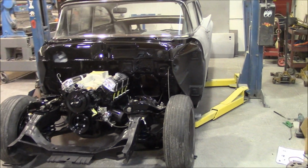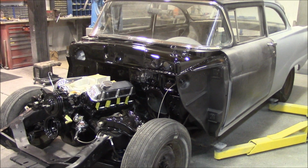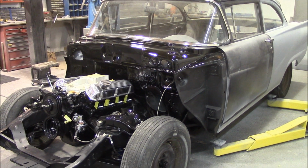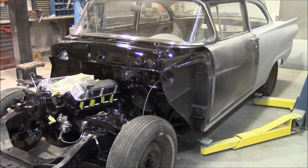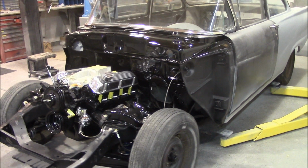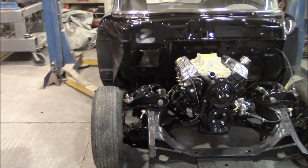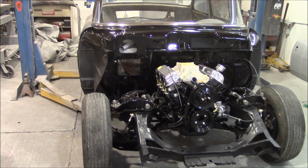I still got to tighten it up a bit, snug it down, but the key to the body, when you're doing it, don't go around and tighten one super tight. I kind of start in the center and work my way out. I'll do one on either side, start in the center, do one on one side, go to the other side, then go kitty corner. And I never snug one down at first and leave it like that. I tighten them all equally until finally I'm happy with it. But there it is, it looks damn good.